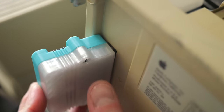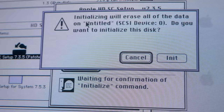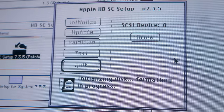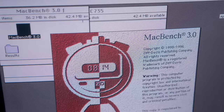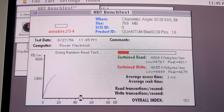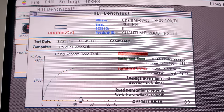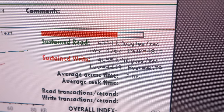The way I tested was largely the same: boot from an external Blue SCSI, format the disk image using the software under test, then install System 7.5.3 and boot from it. For better compatibility, I ran MacBench 3 this time, but stuck with the same version of FWB Benchtest. And this time around, the numbers I was getting back were even more compelling.